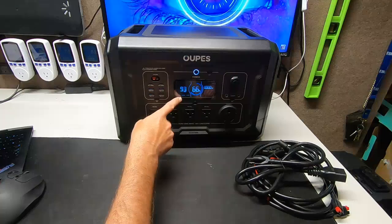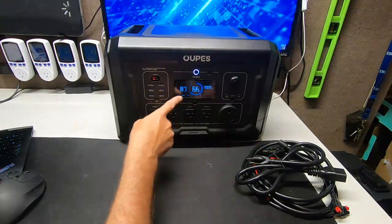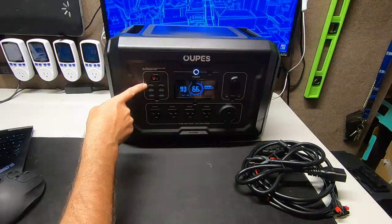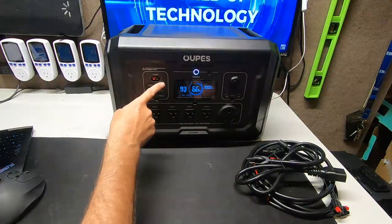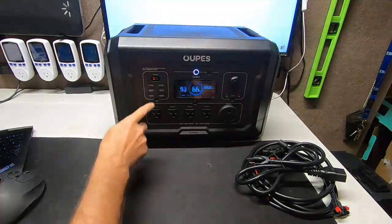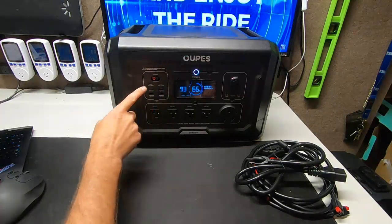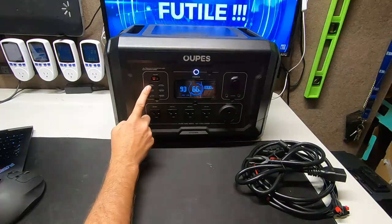So here you have USB A's and USB C's on. And as you can see, it's recalculating as it goes. And then you have power delivery port 100 watts and 100. This is awesome. You know why? We don't have to fight over this port for your phone and laptops. Or 2 laptops. Because remember guys, this comes out at 20 volts up to 5 amps.